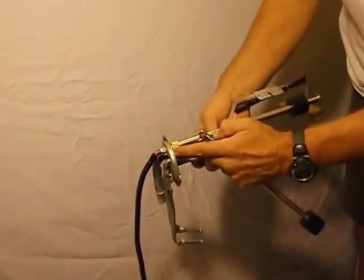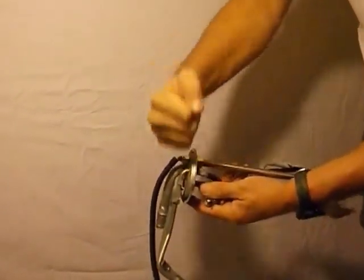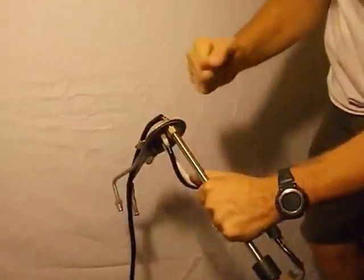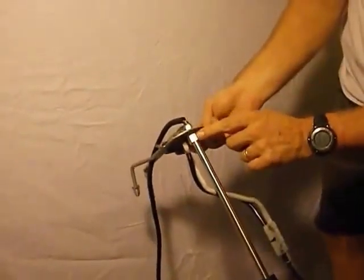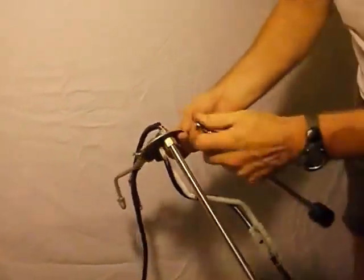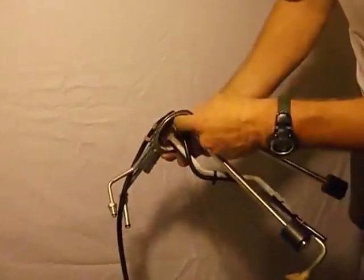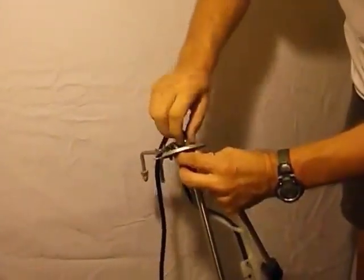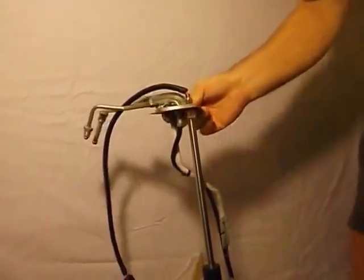You've got to put a wrench on this side of the unit. Do not just tighten this down while holding here — don't try to tighten it with a wrench that way, because you'll actually be spinning the whole thing, turning the wires, and you'll destroy the unit. Make sure this side is stationary — grab it with a wrench either up there or here, then get a 9/16 wrench, tighten it until it's snug, and it'll create that seal on the o-ring.